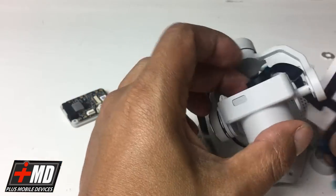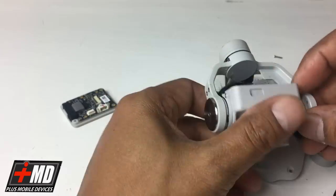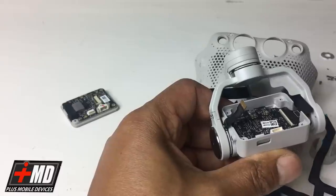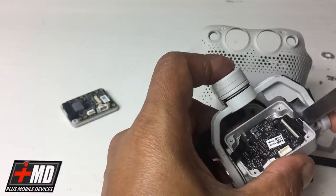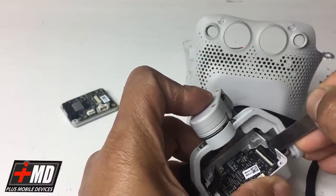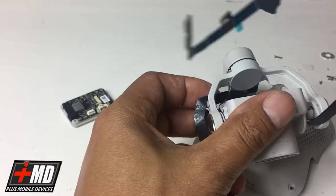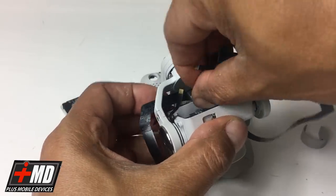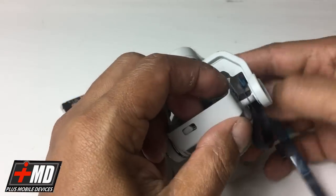Okay, do it carefully. Okay, so now there's an adhesive on the other side. So what you want to do is carefully, this is where you flex. So you see the little white rectangle? That is a point where you actually adhere against the side wall, and this is where you adhere around the shaft. Now you loop it one time around. Okay, so one time around the loop, like what I'm doing now. Be very careful when you loop this not to rip any cables in the process.